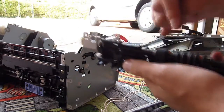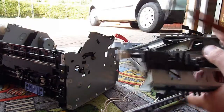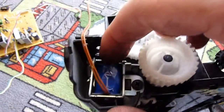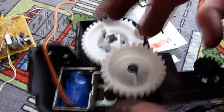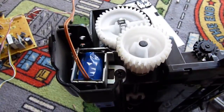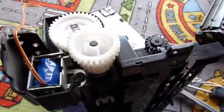You've also got rollers here, which can be handy if you can extract singular ones. I was saying about solenoid and clutch mechanisms — found it. And then this solenoid — there you go: engaged, and then not engaged. There's a clutch mechanism. Well, it's probably not technically a clutch mechanism, but a mechanism that allows you to engage and disengage it using a good old classic solenoid. Worth saving these — they can be handy for various little projects, especially since this is a self-contained unit.